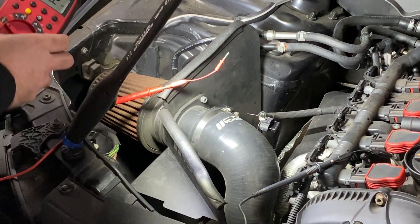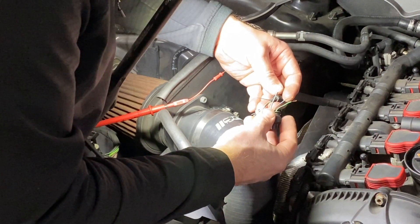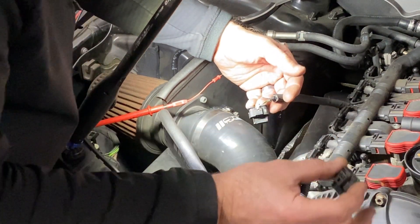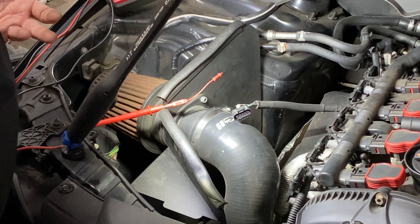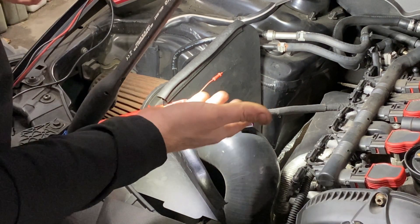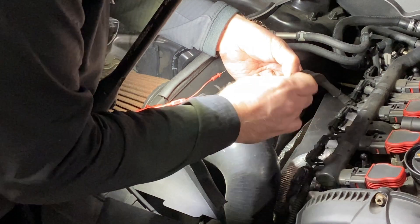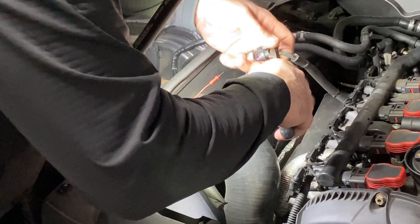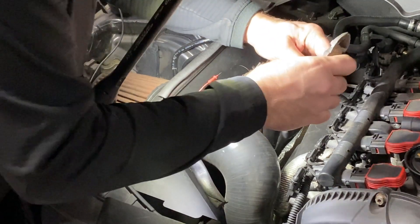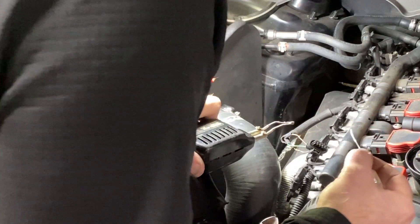I was hoping to do one a little better. However, I was able to make it to the local salvage yard. Colors are the same. It'll give me a couple — like another inch of wire as well. Because this is already tight as it is, and if I go trying to fix this it's just going to cost me time. I think you see what I'm going to end up doing here — cutting this out. I've got a piece of shrink wrap on each wire. I'm just going to solder. Let this thing heat up a little bit.